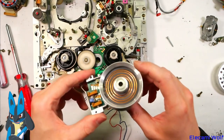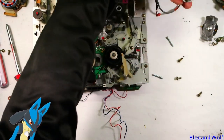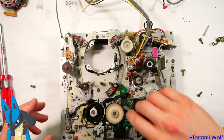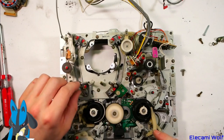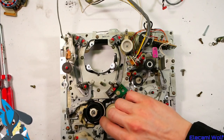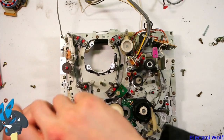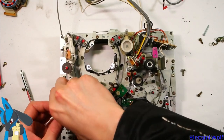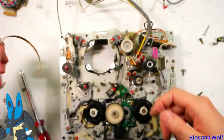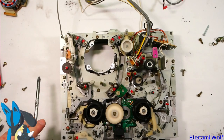The head assembly with its HF transformer thingies — a pretty munted head as we saw before with fluff stuck in it. So it's the normal stuff: there's a supply reel, the guides which wind themselves out, and the back tension band which is still on there — hasn't fallen off, so that's pretty good. But now I've disturbed it, it has flaked off and just flakes off. You lose the back tension and usually find the audio goes bad — that's one of the signs.